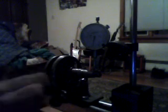So what I'm doing is I'm running on the bearing face on this side. And what I'm going to do is spin it. Now, sometimes I zero it, sometimes I just talk it out here with negatives and positives of 0. Right now it's 0 with the pin at 12 o'clock, if you can see that. So the pin's at 12. So the first thing I'm going to do, in terms of the pin, is the crank being too close at the pin or too far away at the bottom here, that's all I really care about.